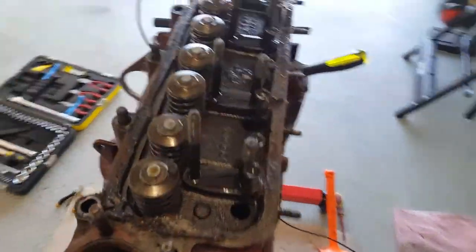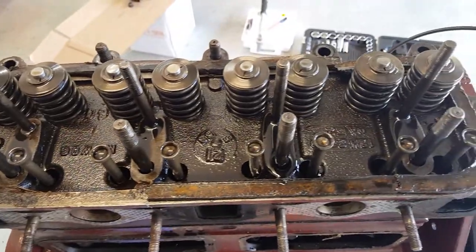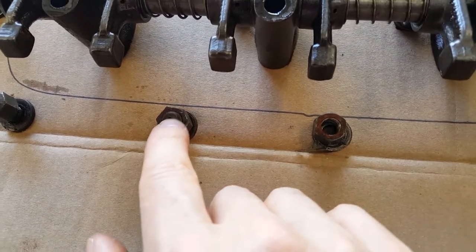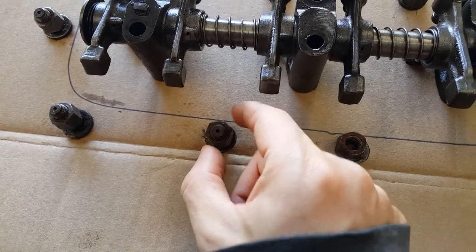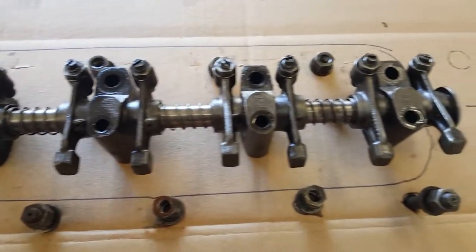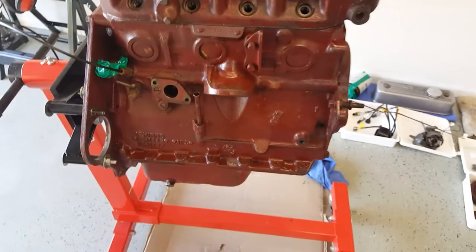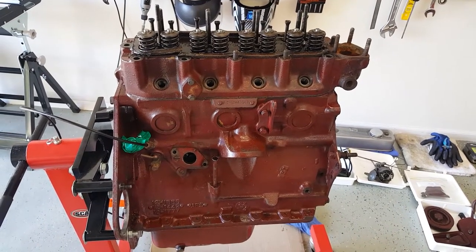For the time being I'm just going through, trying to keep everything orderly. The engine turns over nicely, it doesn't seem like it's seized, but we've obviously got to have a look at the bore and the pistons to see if there's any work been done on the engine before. It strikes me that this has probably had a little bit of work done, because on some of these nuts - the ones that came out with the head bolt - they've been turned between centres on the lathe. There's a little depression on the top of the bolt, so it's obviously had some work. Most of the nuts are just coming off with the washers. I'll keep you posted with progress - I'll try and flip it over, take the sump off and show you the internals.